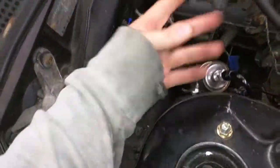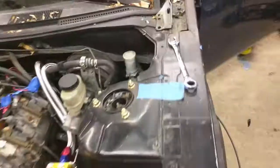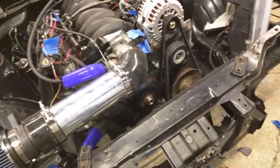I still have a lot to do — I've got to run the brake lines, and I might reuse the same T-fitting setup I had before to connect the front to the rear from the master cylinder. I still have to run the clutch master cylinder; I still have the stock one in here and I've got to make an adapter — that's going to be a pain but I'll wait until I'm ready to hook up all the lines. I've still got to pull the engine out, put the clutch in, and order the driveshaft, but we're getting there — it runs, and that's the most important thing.